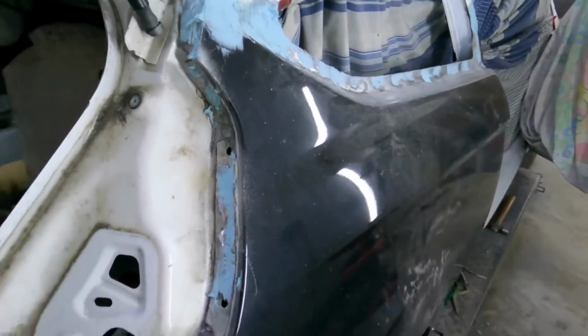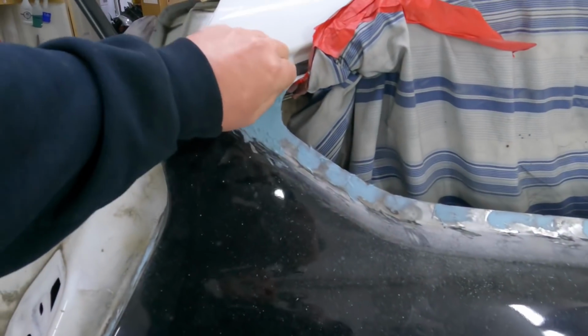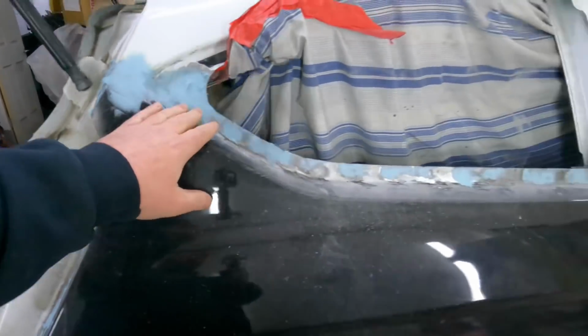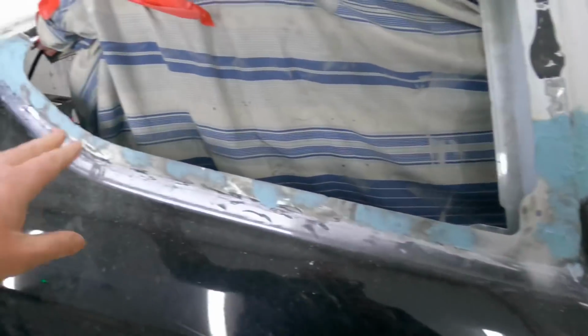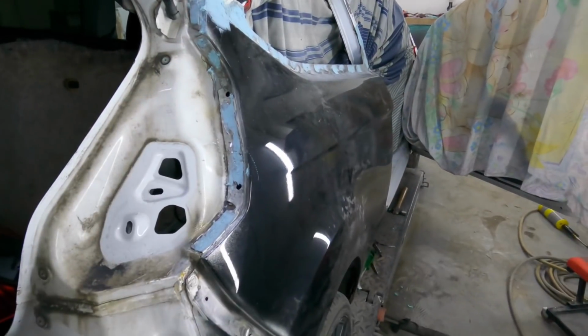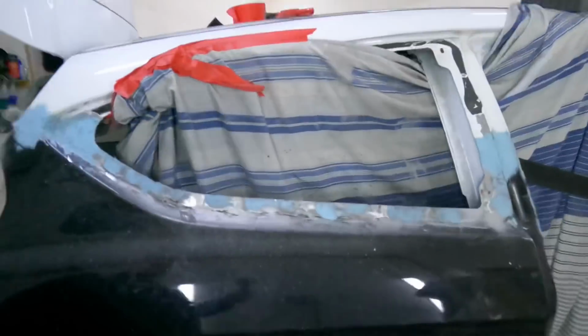Well, I call it bridge gap, always called it bridge gap. Got my fiberglass on now. Reason I use fiberglass is because it's not porous. Normal body filler is porous and this is non-porous, so always use that first for things like that. Block that down and put a skimmer filler over it, so we'll have that all looking nice. We'll get that sorted.